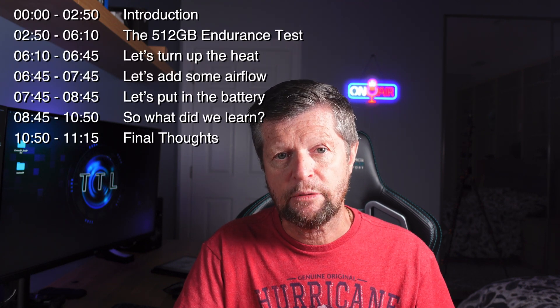If you are plugged into an external power source, the situation is even worse, because now you have the combined heat from the camera recording at 8K as well as the heat of the battery being charged at the same time. In my testing, when recording in 8K plugged into an external power source, the best I could get was around 54 minutes. But there is another option to look at when plugged into an external power source, and that is removing the battery. So that is what we're going to be testing today — plugged into an external power source with an empty 512 gigabyte memory card, to see exactly how long we are able to record for.